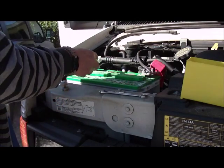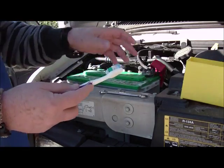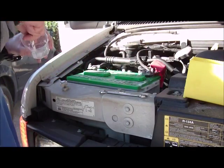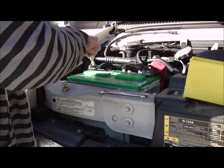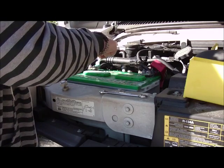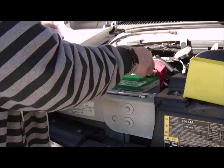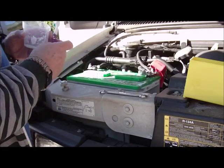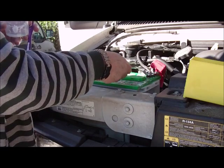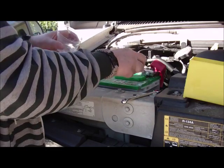Then you take the paste and rub it all over your battery terminals. We're going to need a little bit more water. There we go. That neutralizes all the acid and all the residue from the battery. Now I've already loosened these battery terminals with an appropriate wrench — simply turn the little nut on the top. And you can see the battery terminals are already loose.